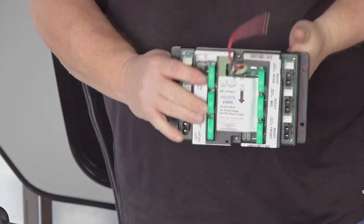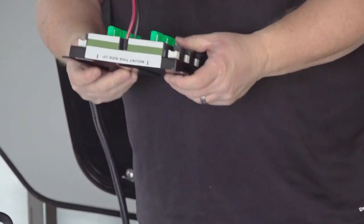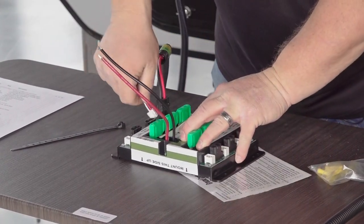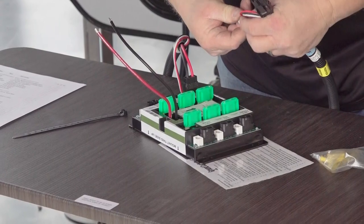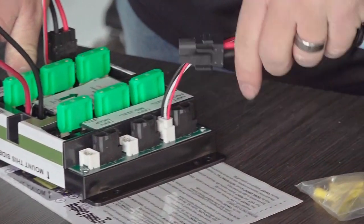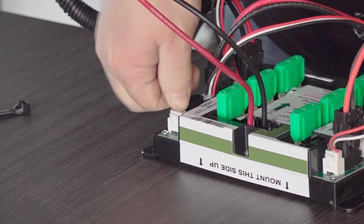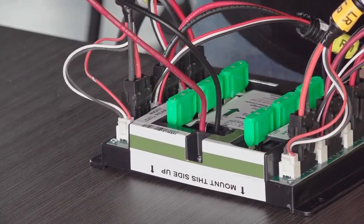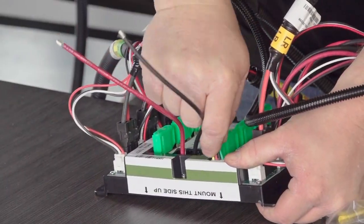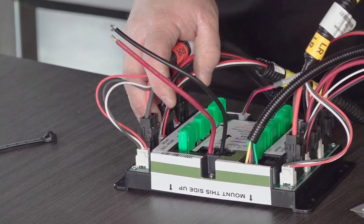Familiarize yourself with all instructions located on the controller's label. Install all 6 jack harnesses, power connector, and communication connectors to the corresponding port on the controller. Each harness will have a tape label indicating which side it's on, or where it is on the unit, left or right, front, middle, or rear. Connect the rear sensor and LCD touchpad harnesses to the controller.